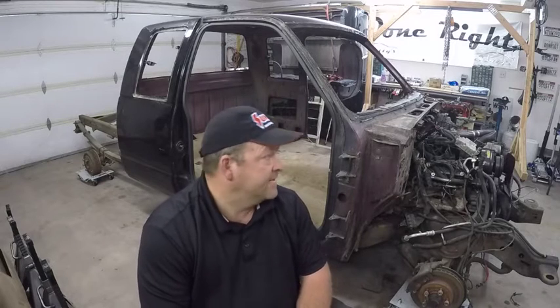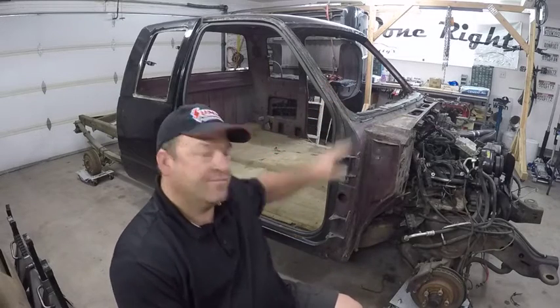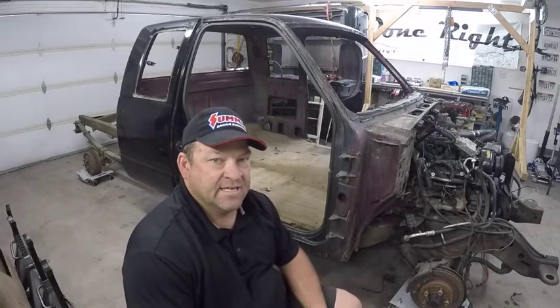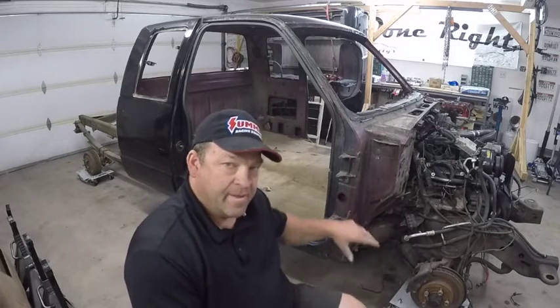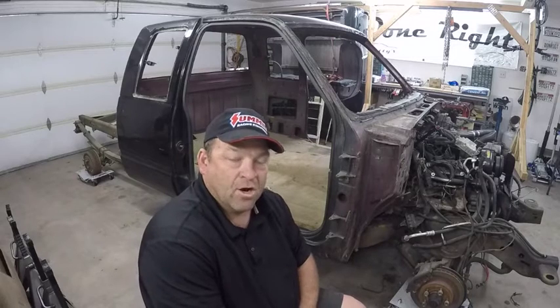Today's the day we're going to pull the cab. I went to Harbor Freight and Home Depot and got a couple items to help get the cab up high enough off the ground. I bought some four by four boards, eight feet long, and some jack stands. The jack stands at Harbor Freight were about $106, but I needed six ton jack stands anyway. The wood was about $30 at Home Depot — three eight-foot long four by four boards. My plan is to jack the cab up high enough to slide the rails underneath, put the jack stands under, slide the frame out, and the cab will stay put. Then I'll use my cherry picker to lower it back down.